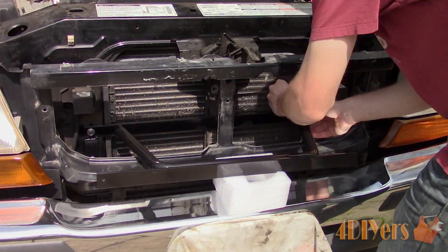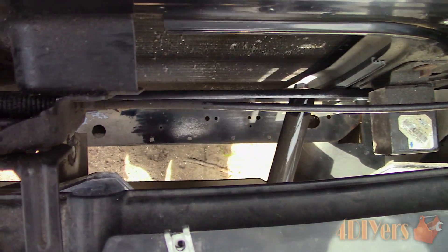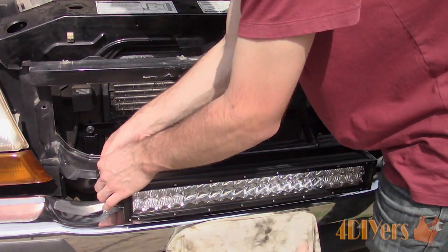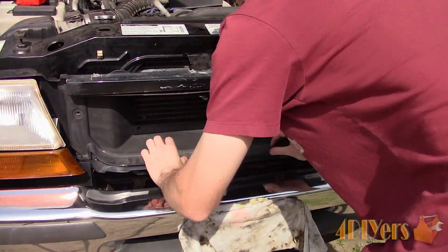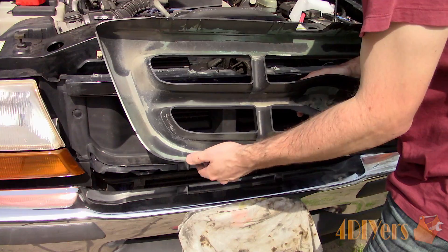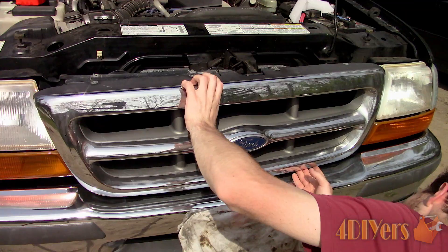Here's a little preview of what I talked about earlier so you can see the whole setup before the grill and diffuser is installed — a close-up preview from a few different angles. Hex head bolts were used for the tubing — if allen head fasteners were used the clearance for the allen key may be too tight, but with a wrench I can come alongside the bolt. There's absolutely no flex in the fabricated mount, all the welds remain very well hidden, and the bar should be quite durable. Finally I can install the plastic diffuser, which installs in reverse of removal — make sure those push clips are seated correctly. This is what I'm left with: it fits quite clean, very well hidden, and there is no need to leave the diffuser out. A similar idea could be used for a light mount behind the grill too, depending on what type of grill your vehicle has — this truck has a thicker style grill which would block the light output compared to a mesh style grill.